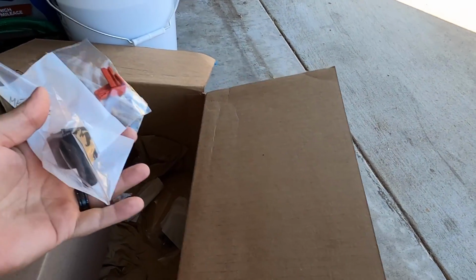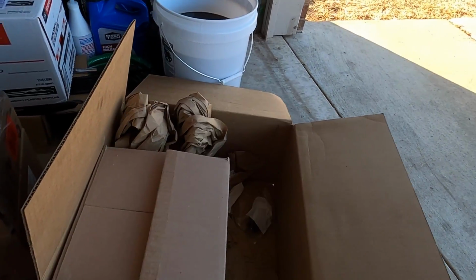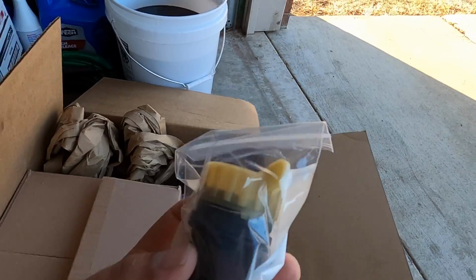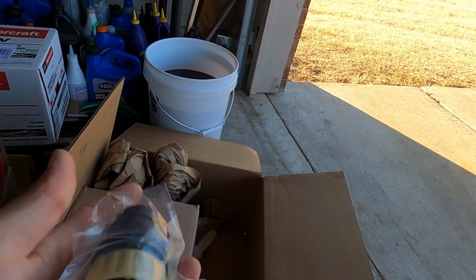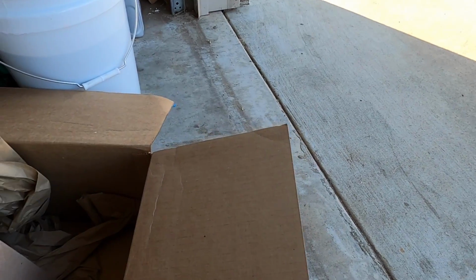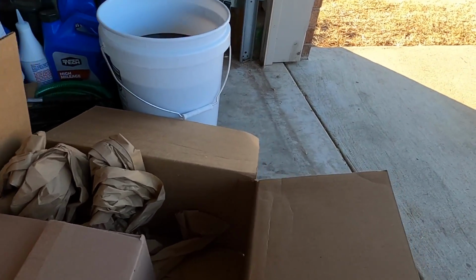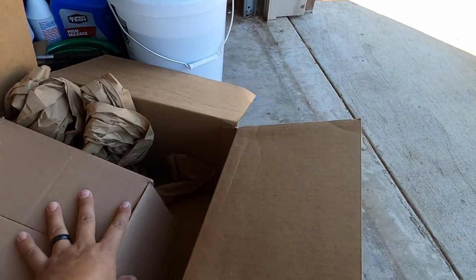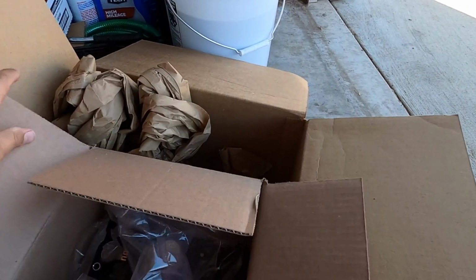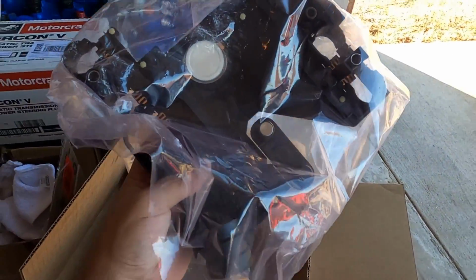We got so many parts. These are these tamper-proof transmission seals. There's the little tabs that go to them. This is the connector itself. Has an O-ring right here that tends to go bad, so you always want to do this when you're doing them. What is this? Oh, we got the little crush washer for the drain plug. I mean, this is an entire kit that you can get from FCP Euro's website, and here is what I believe is most likely the culprit, and that is the conductor plate.